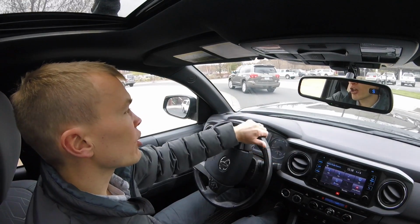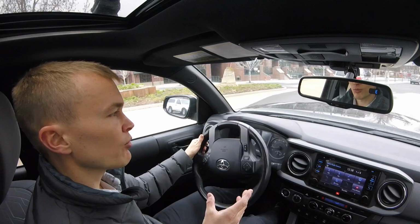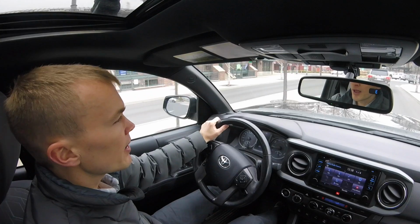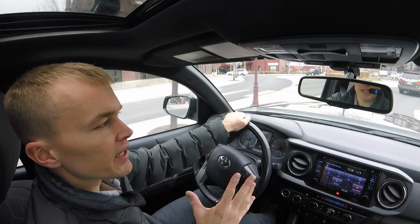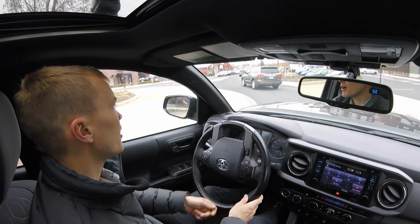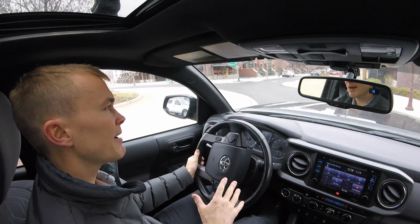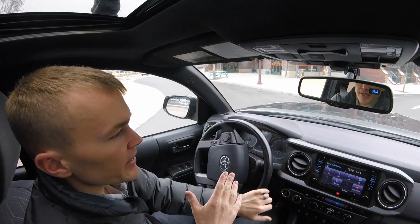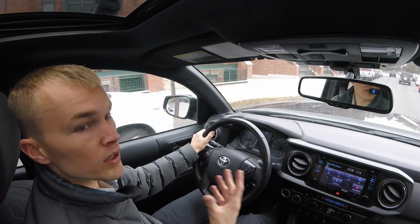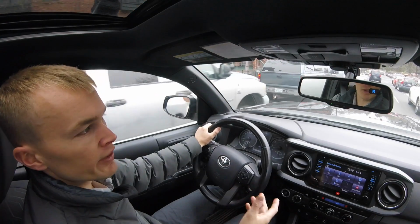And what that is, I've got a really subtle vibration when I first use the vehicle in the morning, or if it's cold outside when I use it after an extended period. And what that really consists of is every 10-15 seconds, for just like 2 seconds, there's this really subtle vibration. It's almost so subtle you don't even notice it, but at the same time it just kind of drives you crazy. And so it kind of vibrates, and then it goes away, and then it comes back. Once the vehicle's warmed up, it goes away. And if you shift it into four-wheel drive, it also goes away.